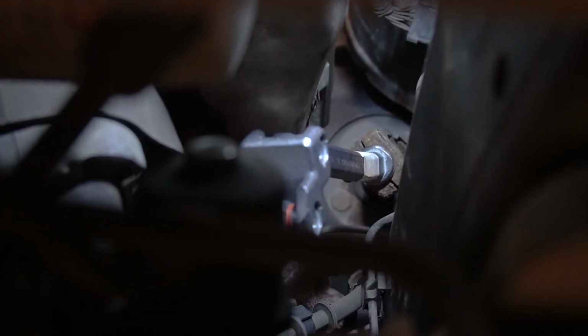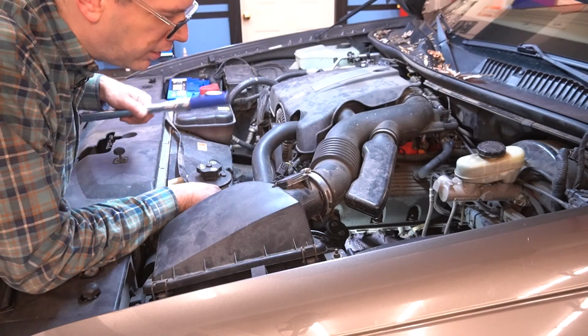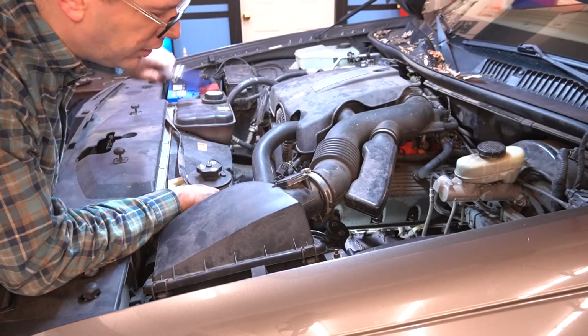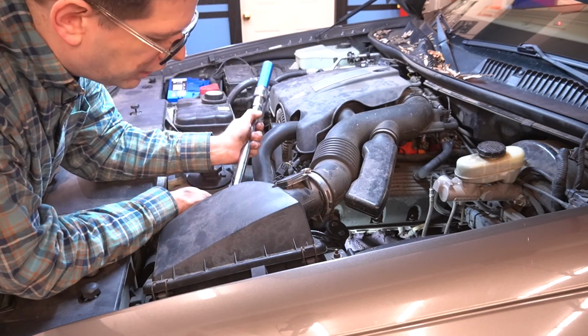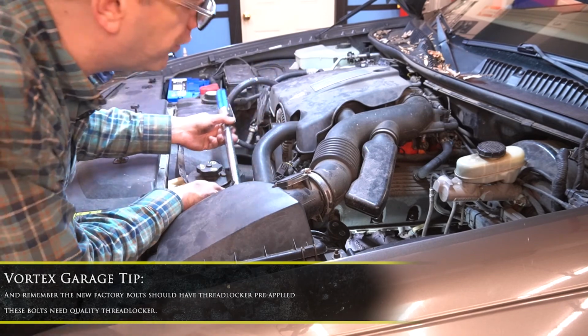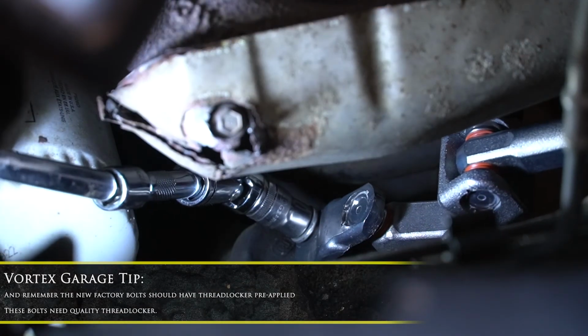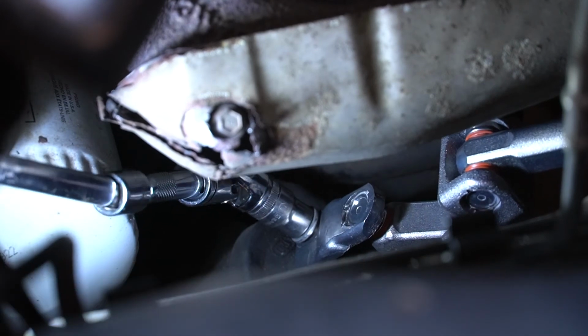And we can push this back down, and then we'll go ahead and get our bolts in, and that'll lock everything in place, and then all we got to do is torque our bolts. Again, making sure that we don't turn our steering column shaft. All right, now our smaller one is 22 pound-feet. So we're going to go ahead and tighten that and torque it. Now, the big thing, using all these extensions, it's going to add some torque. So you want to make sure also you're not binding on anything and that you're going in nice and smooth.